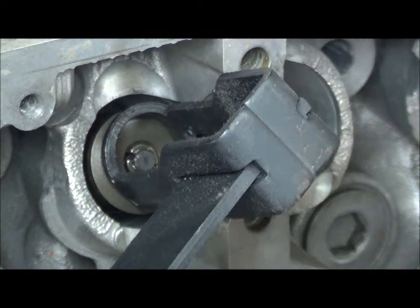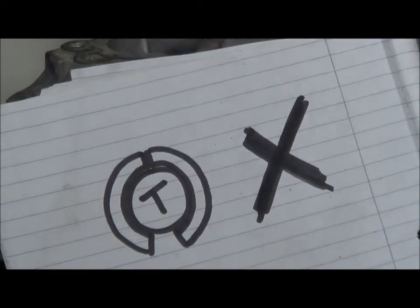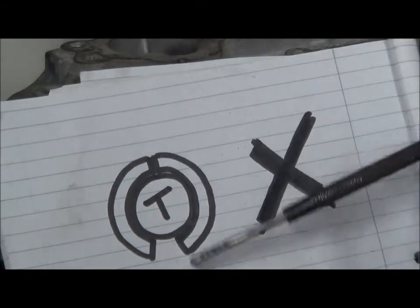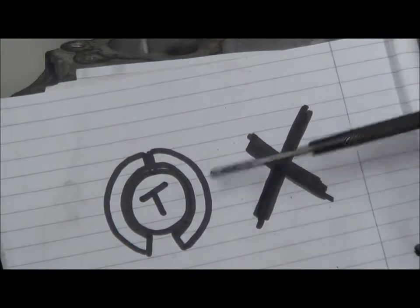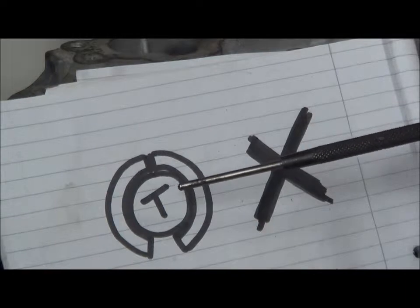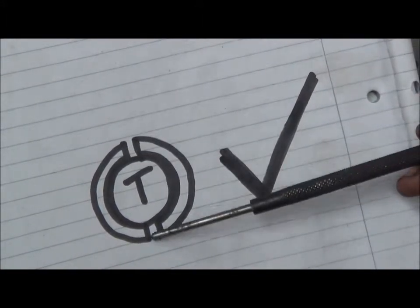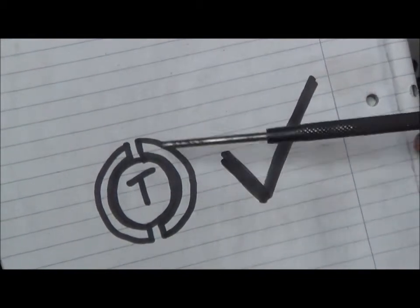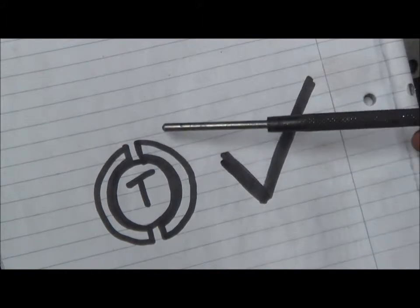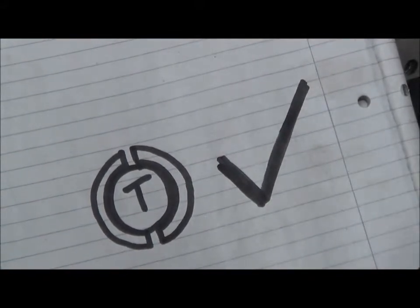Something very important is that the keepers — I've done a little drawing here, because my artistic skills are excellent. Basically this is the tip of the valve and these are your keepers. They'll have a tendency to want to sit unevenly sometimes, and this is bad — you don't want this. This is unevenly distributed pressure against the valve; it snaps tips and can wear your retainer in a weird way. The right way is an even gap between the two — there'll always be a gap. If these two are touching they shouldn't touch; there should be clearance. Everything expands with heat and you don't want these starting to crush the valve, because they'll pop the head off.